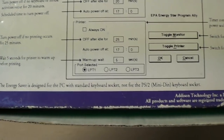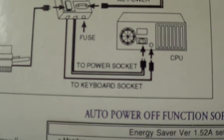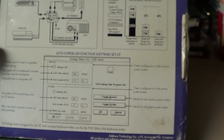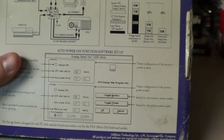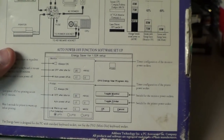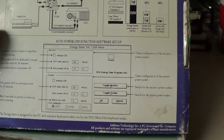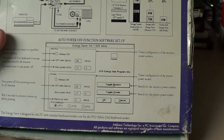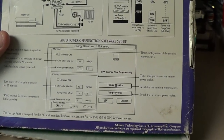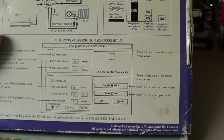This has to be controlled by the computer in some way. And rather than using something like the parallel or serial port, it actually uses the keyboard socket as a means of control. I'm interested in knowing how it would do that — I suppose it used unused keyboard scan codes. Most people think of the keyboard as an input-only device, but that's not strictly true. Because there is a microcontroller within the keyboard, you can actually send commands for it to act upon. You can toggle the state of any of the lock keys, check for the presence of a depressed key, or even change the keyboard scan code set.